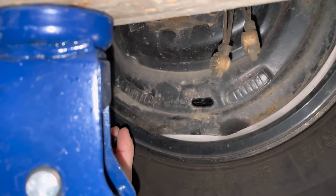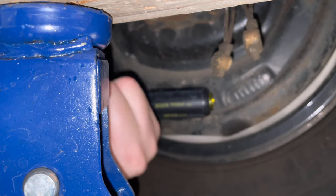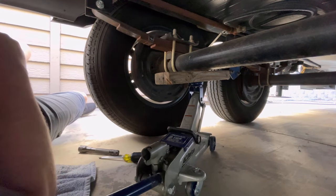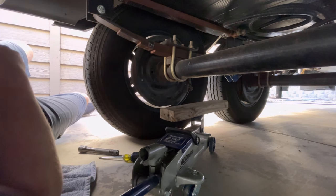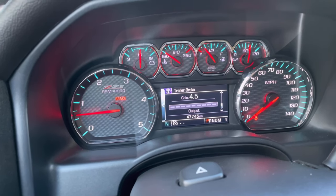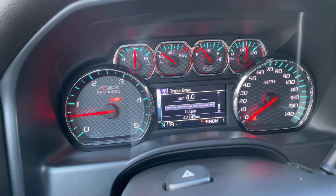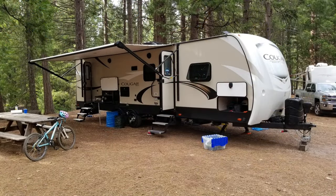After you get a decent amount of drag, put the protection cap back on and make sure it's seated all the way so dirt and contaminants don't get in. You can see the drag I have now — that'll adjust once you're back on the road. One more step: go to your trailer brake adjustment and drop those gain numbers back down, then find somewhere safe to test and readjust. After that, you're safe to get back on the road and travel.